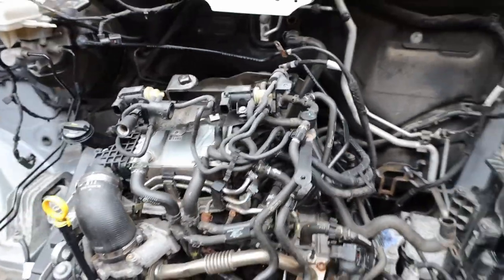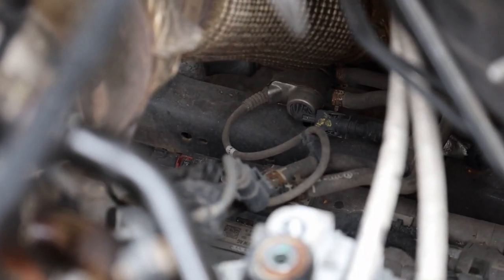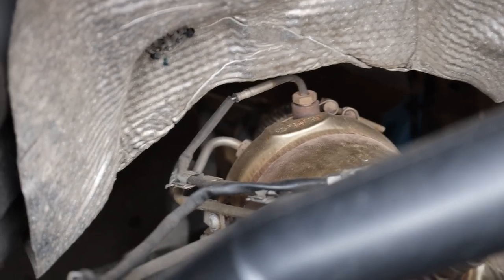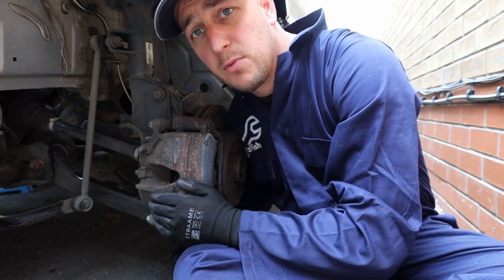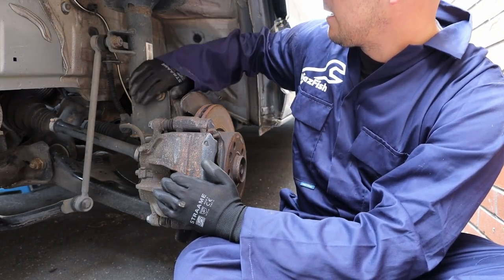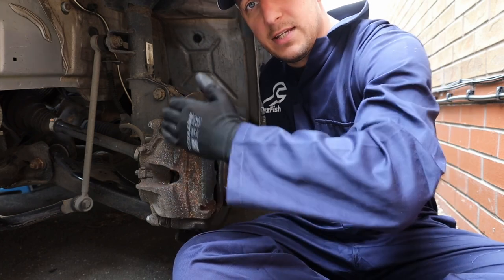From up in the engine bay perspective, just one little grey clip under the ECU wires to come off. There may be a few diesel lines we need to disconnect and then a clip which is down behind the engine - and that should be it. We do obviously need to disconnect the exhaust and both drive shafts. For the exhaust there's just a couple of hoses there and an electrical connection, and on the other side there is another hose as well. On the top of the down pipe there's a nut to release and then the clamp will come off so we can slide it out. We also need to detach the drive shaft from the gearbox - take off the ball joint on the bottom, take out the retaining nut from the end of the drive shaft, take off the caliper, remove the centre from the back, disconnect it from the leg, and probably loosen off the steering arm and then we'll be able to lift this out of the way.